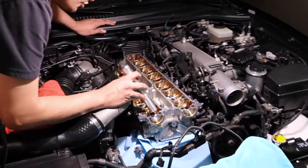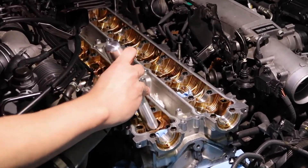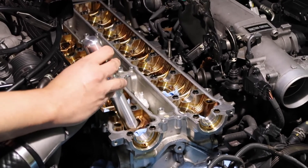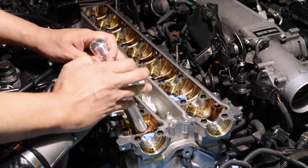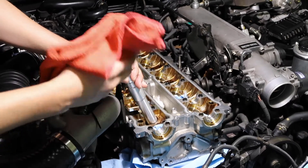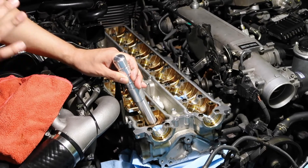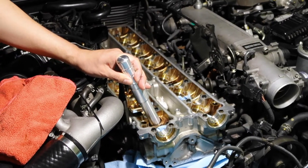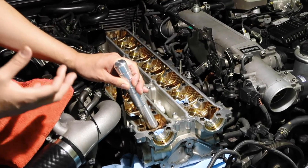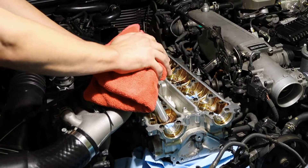What you're going to do is place the tool square — which I just recently learned means make sure it's even. As much as you can, because there's this part right here that's actually going to help us a little bit. At this point I'm going to use this tool because it requires some force. You don't want to hesitate because you've pretty much got one shot — if you don't do it right, one of the keepers will get stuck and give you a lot of trouble. So you've got one good shot to give it a good press.